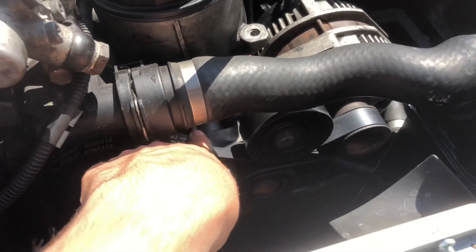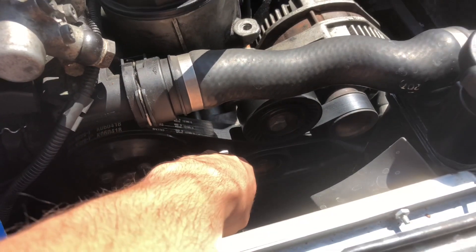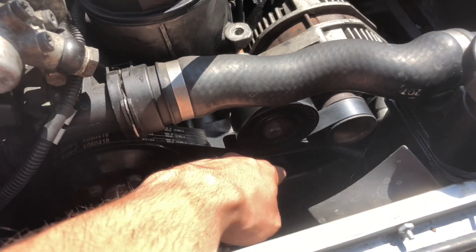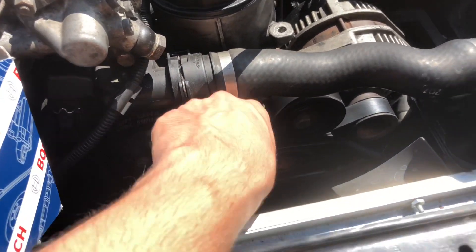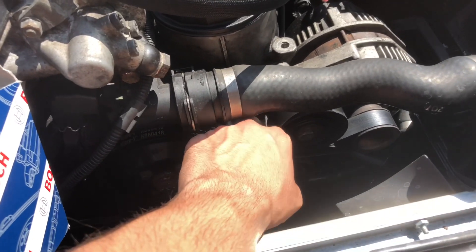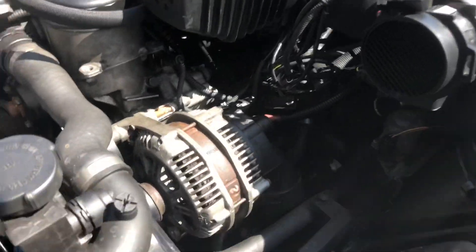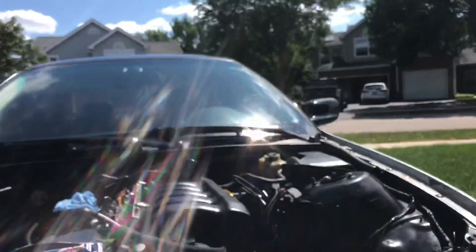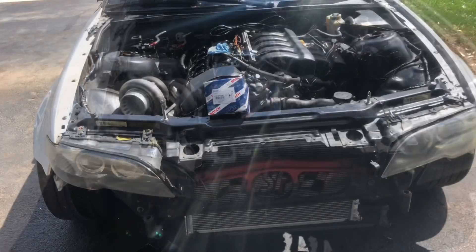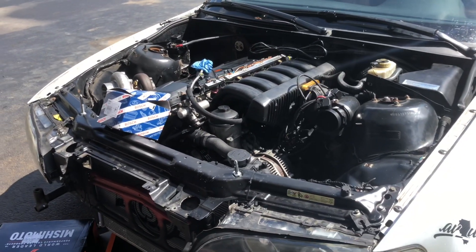One more thing — I had to source a belt. I can throw the part number in the description; it's pretty much the perfect fit. I deleted the power steering, and when you do that the tensioner pulley basically becomes useless — you can't use it to route tension because the belt path is different. You just have to really get it on there. I tried three or four different belt sizes to figure out what I needed. Power steering is completely deleted. I still have the bolts in the rack and I want to block it off — I'll just get some hose to cover it. It's lubed with grease so even though it's a hydraulic rack, it's okay to run without fluid.